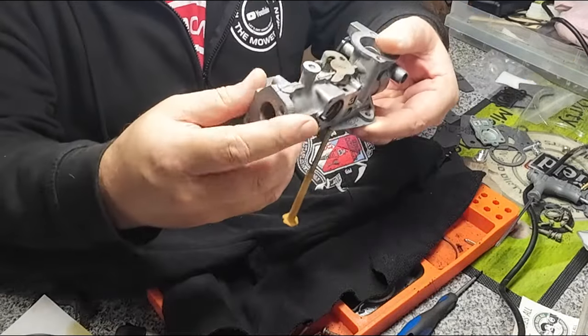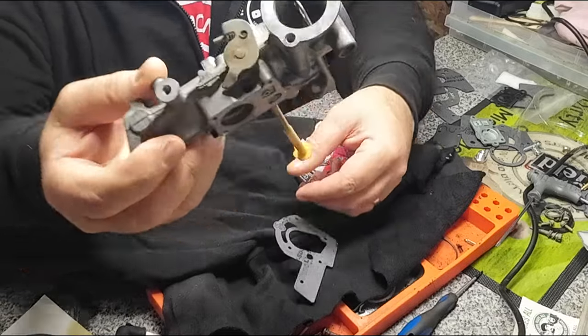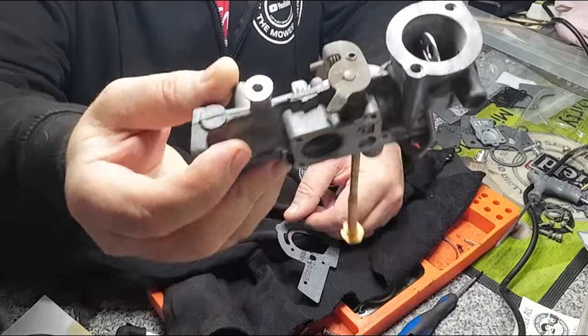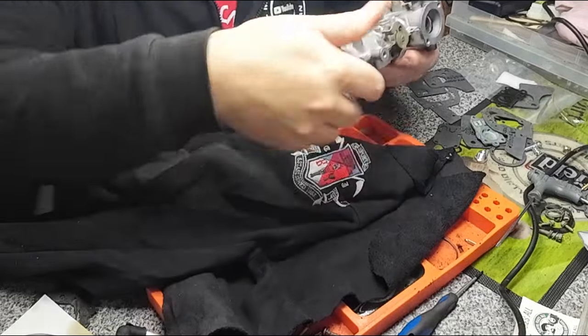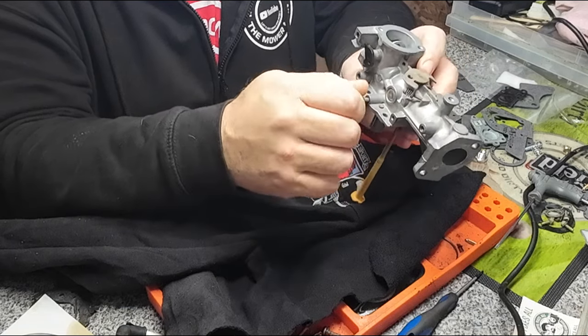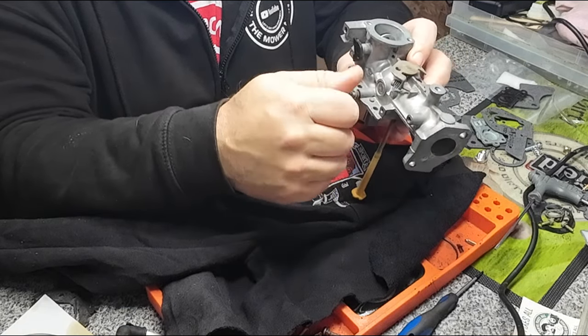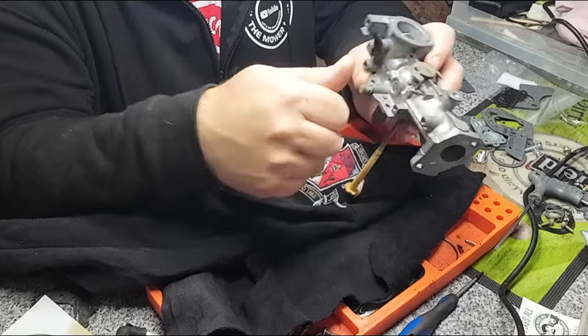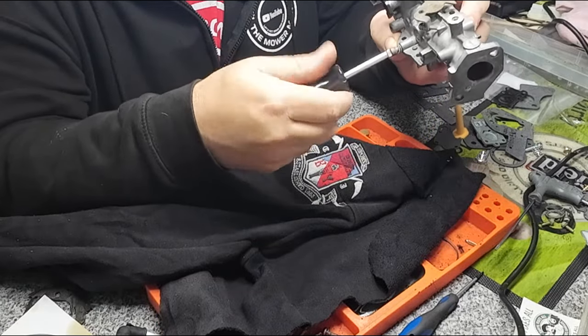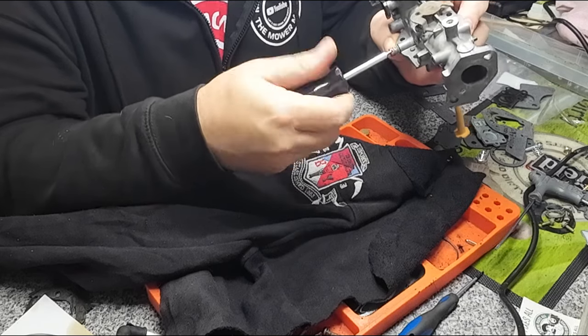And here's a carb in all its entirety. There's a carb, looking nice and clean. We like that. It's really, really good. So all I want to do is put my fuel mixture screw in, which goes into here. Screw it all the way in, and roughly 1.5 turns to come back out. And that'll be roughly where it's set. And hopefully, if the machine all runs as it should do, then...